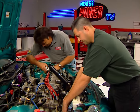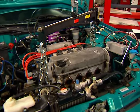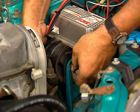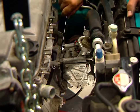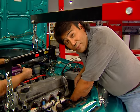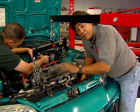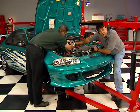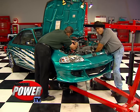Using an adjustable engine lift like this one from TransDapt, we're going to attach these chains to either end of the engine, then we'll be ready for that cherry picker. With the engine supported by the cherry picker, remove the engine mount bolts, the vacuum line to the brake booster, and the AC compressor mount bolts. Be sure to tie the AC compressor out of the way with a heavy piece of wire before you lift the engine out — that's going to keep these connections intact and keep the Freon where it belongs.